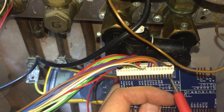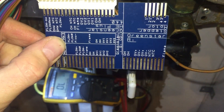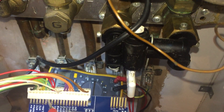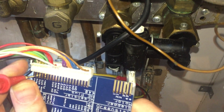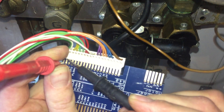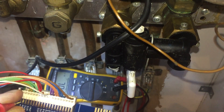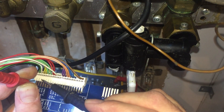With your multimeter set up, simply hold on one pin — open line — and drag this across every pin like that. You would expect certain things, like the domestic water flow sensor with its three wires, to show continuity — and they do.